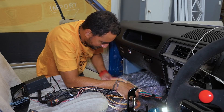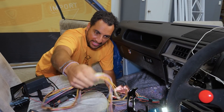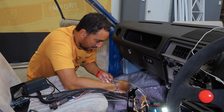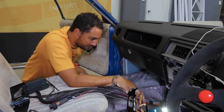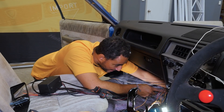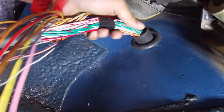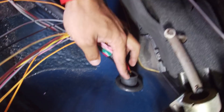I've separated the loom into its sections: the inside component covering the accelerator pedal, ignition switch, and other interior items; the flex fuel sensor and fuel pressure sensor loom running to that side of the car; and everything going outside. The grommet has been moved up to where it's going to mount in the hole. This is a quick test fit to make sure the grommet sits in place and the loom moves freely. I'll squirt a little silicone spray — or tyre shine, which is pretty much the same thing — in and around the area to help the loom slide through more easily.